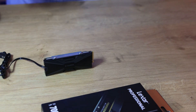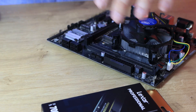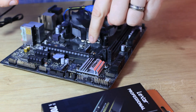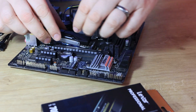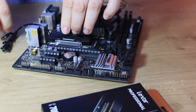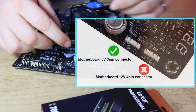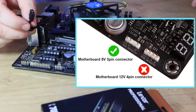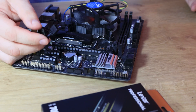Get your motherboard — this is just a demonstration board. You would then put it in your M.2 slot here, just slide it in, then put a screw in the other end. Then get your 5-volt ARGB cable and plug that into the 5-volt ARGB header on your motherboard.